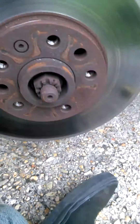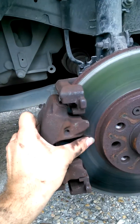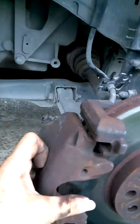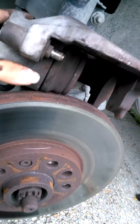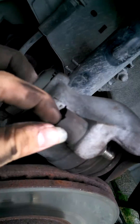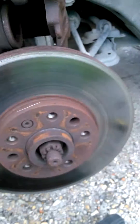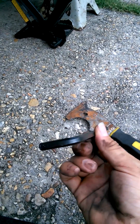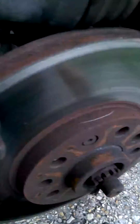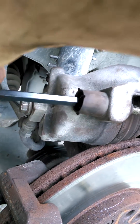When you take off your tire, the caliper is gonna look like this and it's gonna have a pad underneath here. How you're gonna take that off is you're gonna have to go in there behind the caliper. You're gonna have to adjust these so that they are completely loose, and you do that with a seven millimeter Allen wrench. It's gonna go inside and you're gonna turn it until it's loose.